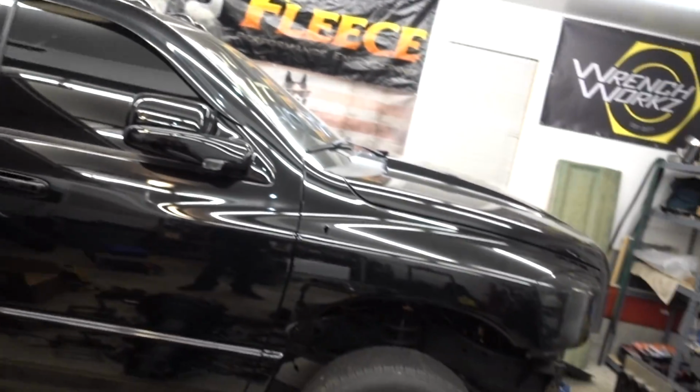But I have to ask you guys a very serious question. If you follow my Instagram, which you should all be doing, I posted the triples for sale. I'm not going to get into what we're doing for next year. Honestly, my mind is all over the place on what we're going to do next year for the race truck. So this truck, you guys still don't know about. The race truck, we're undecided as well. But should we? Now, the manifold charger is a 488. I had that on the manifold as the small turbo in this massive setup, but a 488 96 132 housing could definitely be the big turbo in a set of twins. It's already T6, so that big charger is actually pretty good for a twin setup.